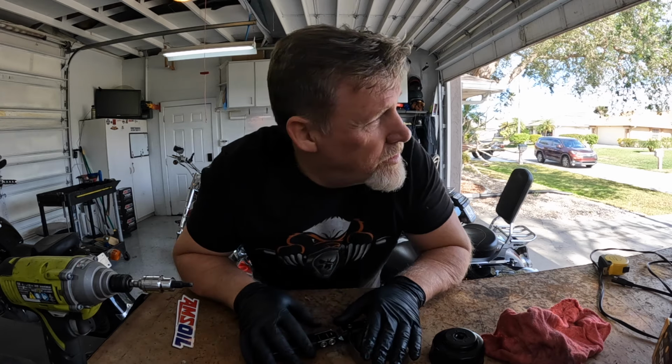So the very first thing you've got to do is, you don't want to change the oil with the engine cold. You want it to be hot. Guess what that means? You get to go for a ride. Now, if I could start all my jobs out with going for a ride, how could you hate that? Anyway, go for a ride, get your bike all warmed up, nice and hot, and then bring it in, and this is what we'll do next.